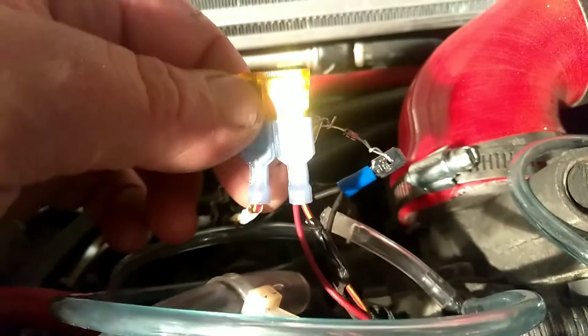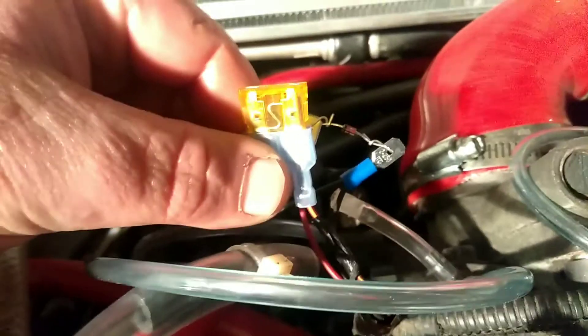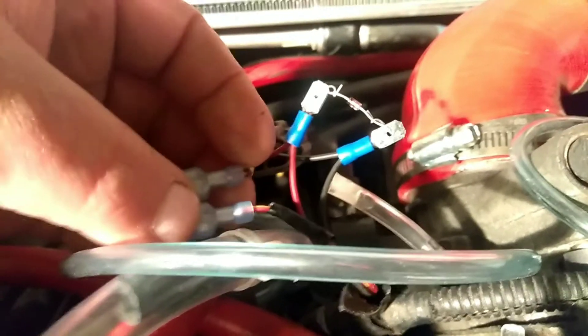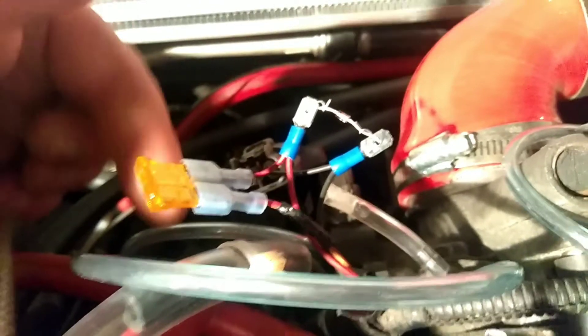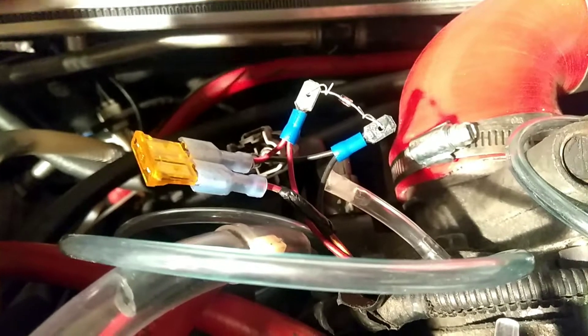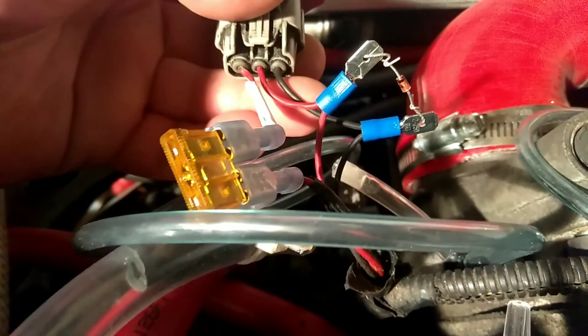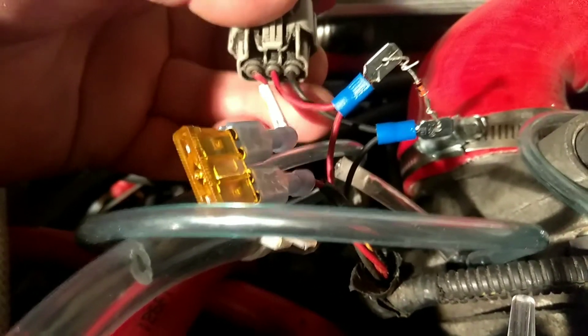This you don't have to do, but the ECU already has fuses. I don't know where they are or how they work, so I just put in my own fusible link here, just in case I shorted something out or something melts. You don't have to do that, but I was in overkill mode. Your middle wire is your signal and the one to the far right is your ground, so you want to put the diode between your signal and your ground wire.